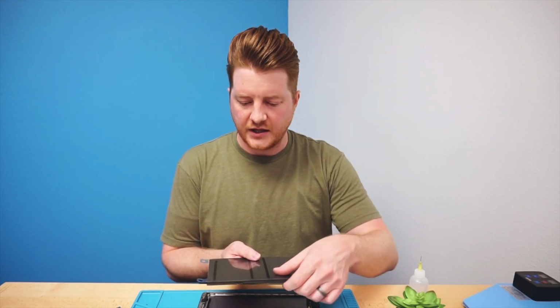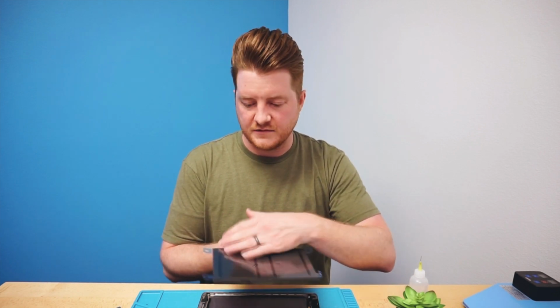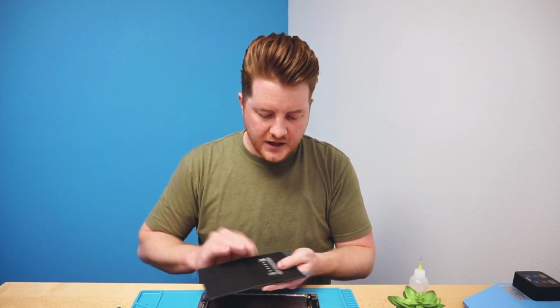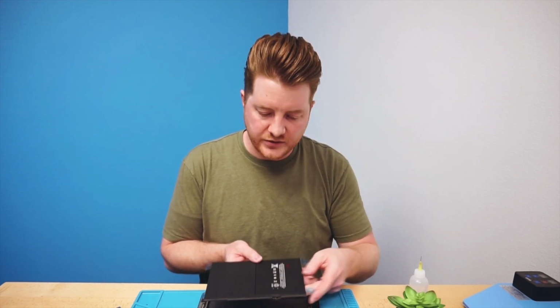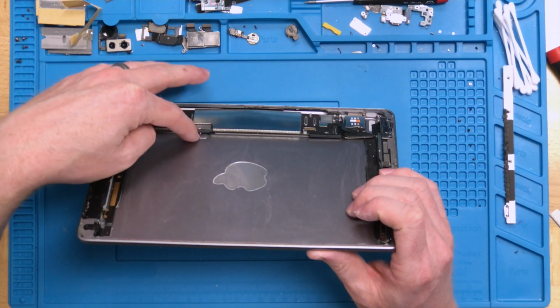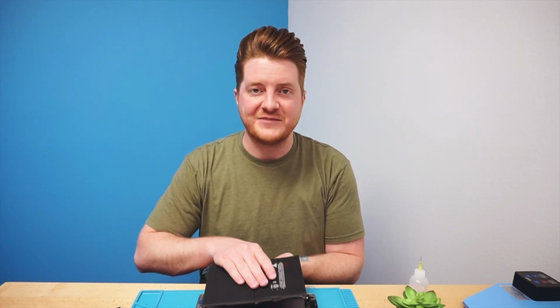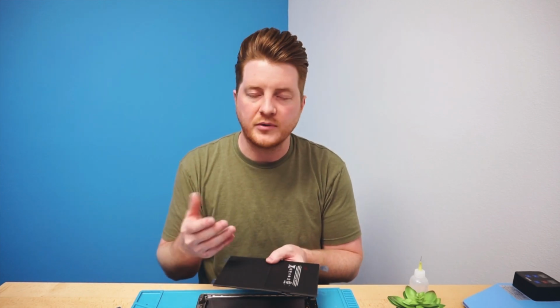You want to go ahead and pull off the bottom of the cover where the adhesive has its protective cover on there. But you do want to make sure that you understand how this hooks on. And so if you have not seen a bare housing before, I would definitely tip it up on its edge, look down there, make sure you can identify the nub itself to see how you need to hook it over before you put your iPad battery on. That will alleviate a lot of issues that you may experience if you set the battery in before it's fully on the notch, or if you get it in and you can't get the battery tab to sit fully flush. It's probably because you're not centered on top of that standoff.